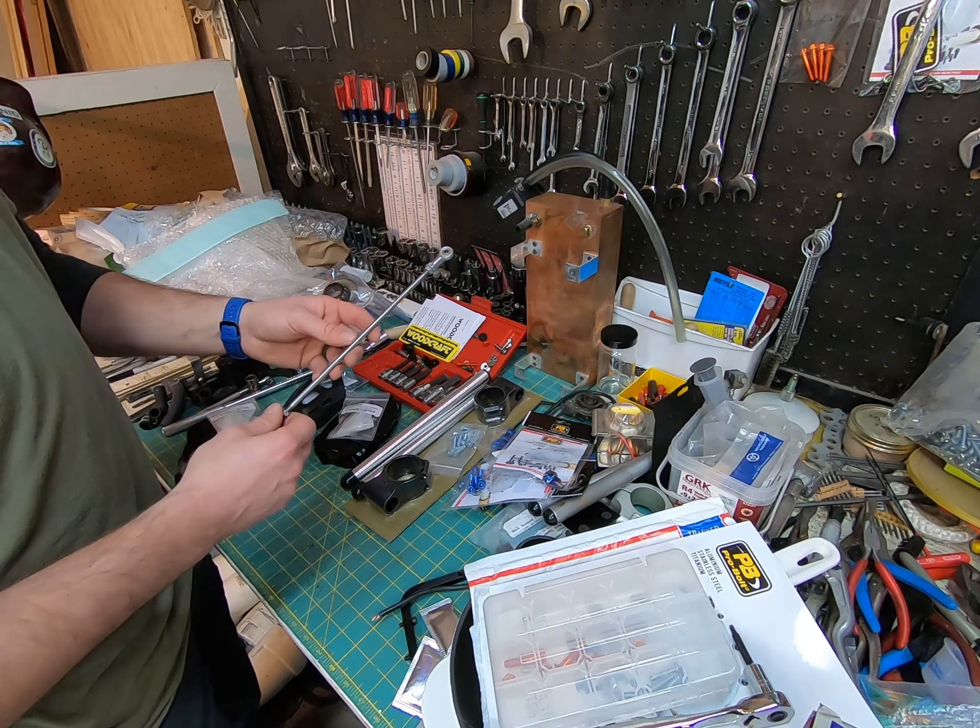I also got their three-piece clip-ons. I have these on my SV650 and absolutely love them — makes it super easy if you need to do some maintenance or repair, being able to take those off without having to drop the forks all the way out of that upper triple.